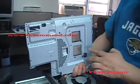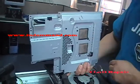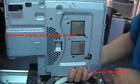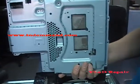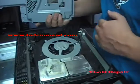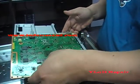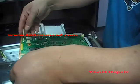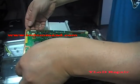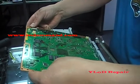This will expose the board. Here are the two heat sinks and here's the video chips, which we will reflow — do a thermal reflow on them — and put them back in. Check your fan; if you're going to replace a fan, do it now. Let me remove this from this — it's going to be easier this way. Lift up a little bit; sometimes it's going to be a little tougher.